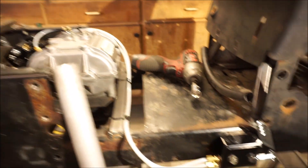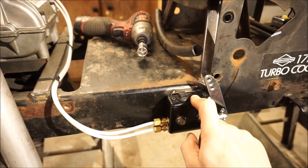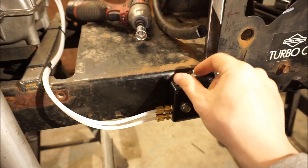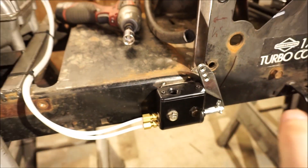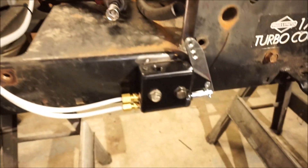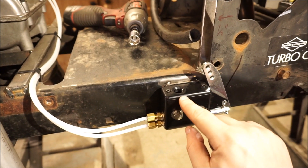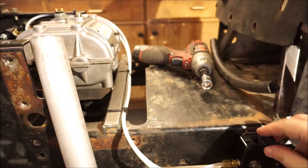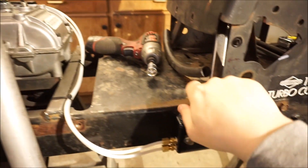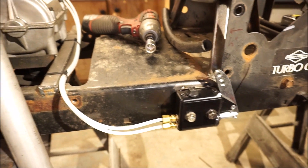One more thing I've experienced: when bleeding these brakes, when you fill the reservoir to the top with brake fluid, you need to keep topping it off. Every time you prime it you need to refill it again, otherwise you'll run it empty and just be pushing air into the brake lines. Constantly fill it — every time you pump it to prime it, put more in every single time. I kind of wish they had a bigger reservoir, but you could run an external one.